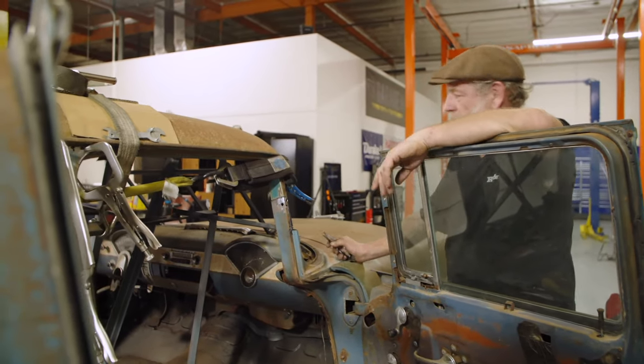We've now welded all the outside on all the pillars and welded the inside on the front and back. I'm just going to weld the inside of the B-post - we've already plug-welded the outside and up in the top. Three welds each side and that's the end of it. That wraps up the welding. The new roof is on there. It doesn't look much different than when we started, but it's a lot stronger. It was really rusty up inside and in the pillars, especially the rear. So it looks the same but it's a lot stronger.